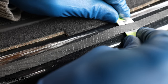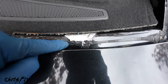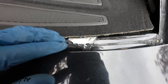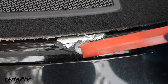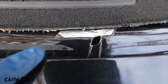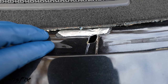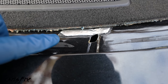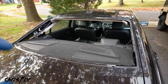Something very interesting — while shaving the urethane down, I found a factory mistake. The factory put sound deadening over an area and then put the urethane over the sound deadening, which is incorrect. You can't bond urethane to sound deadening — you have to bond straight to the metal surface. So scrape up the sound deadening as well as the adhesive under it, and use a towel with alcohol to remove any residue. Never apply your urethane to anything except the pinch weld.